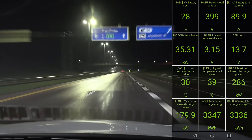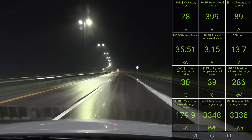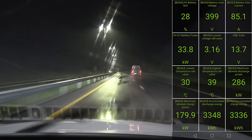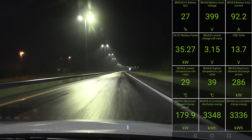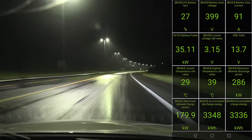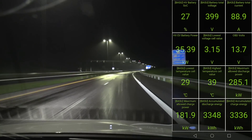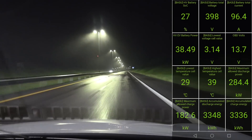We've been driving for a while now, and the temperature has stabilized at 39 degrees Celsius. Initially it dropped quite quickly from 43 to 39, and it seems like we've hit equilibrium where the discharging heat is so high that the temperature doesn't drop anymore. I suspect right now we just get some passive or fan-only cooling on the battery. That's why we don't see lower than 39 degrees. Also, there's a whopping 10 degrees Celsius delta between min and max temp in the battery — that's not good. It should be as low as possible, ideally zero or one degree. Some of the best cars I've seen — like Tesla — are usually hovering around one degree, sometimes going as high as three or four degrees delta.